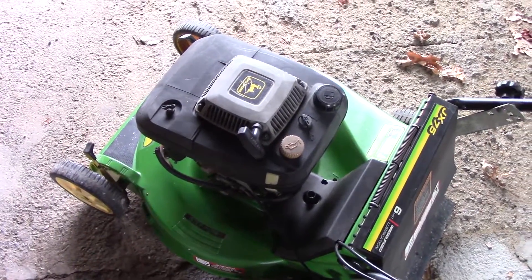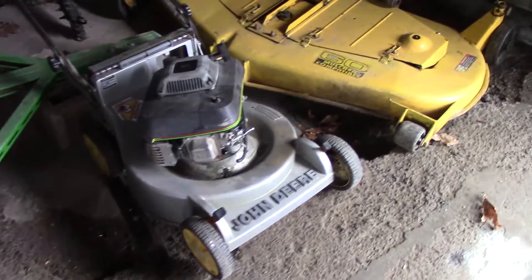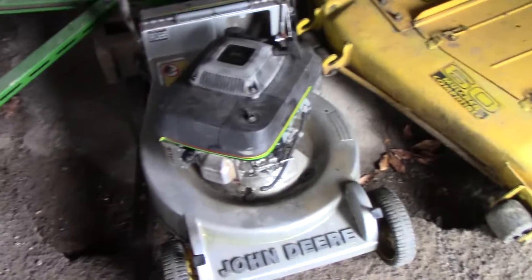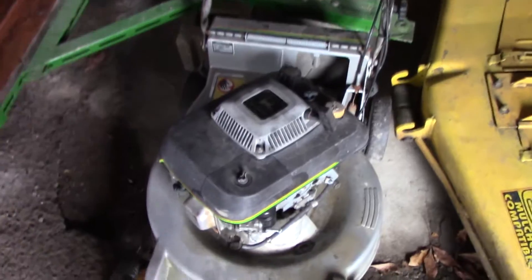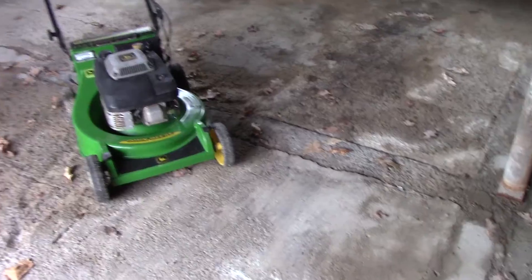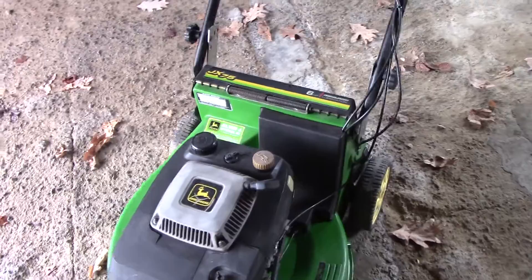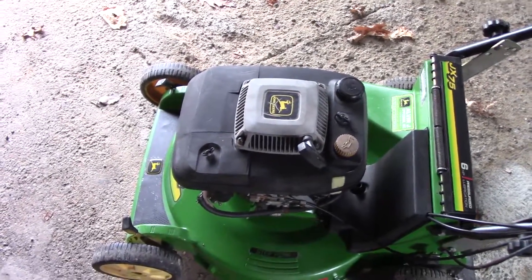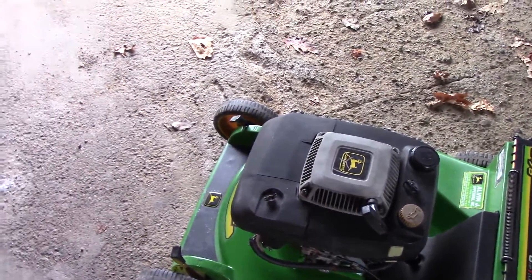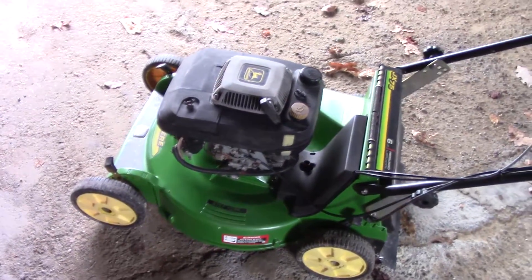So that's actually the motor from the 14SB. You can see here's the original JX-75 motor right here, what's left of it. Luckily, these are both pretty much the same machines, so I just swapped them — they look the same. I think technically this motor is like 5.5 horse, but I put the carburetor from the JX-75 on this, so maybe it's about 6 now. That's my guess at what makes a difference.